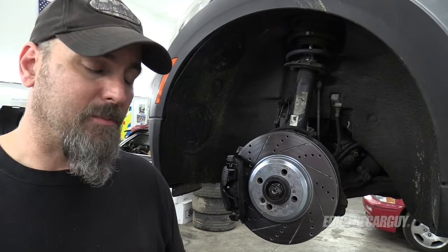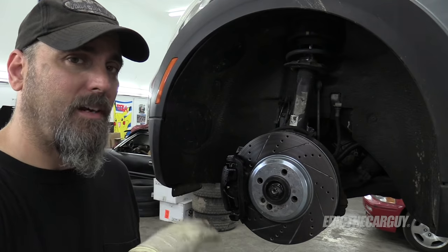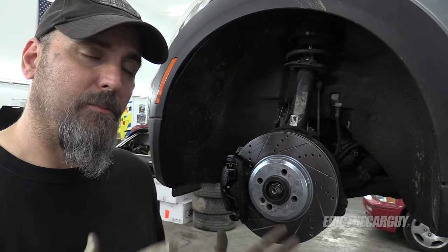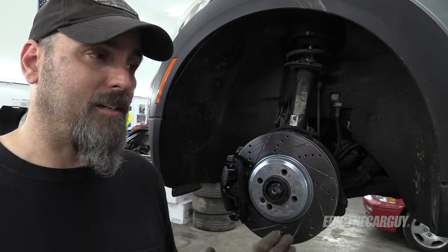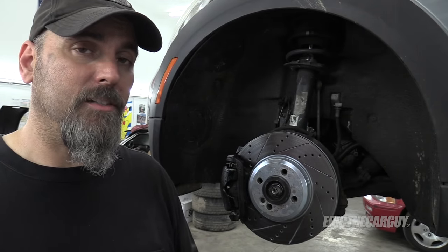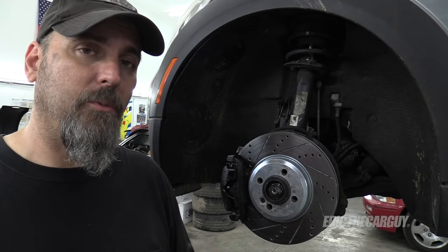That is how I paint calipers. I'm not going to claim to be an expert, so feel free to leave comments down below about your tips and tricks for painting calipers. Personally, I'm not a fan of leaving everything in place, spraying it, and relying on a couple of brake applications to get the paint off the rotor — I don't like that. From everything I've learned about painting, it's 95% preparation. The better your surface is prepped, the better your paint job is going to look and last. Sandblasting would be the ideal; a wire brush can work fine. I will link in the description videos about doing disc brakes and more about this mini — I've done a whole series of videos about it.